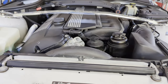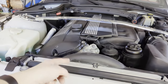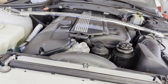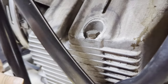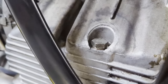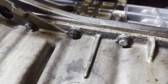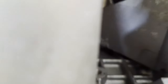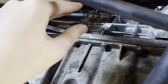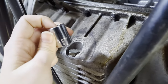If you're not working on a BMW, your filter may be screwed in underneath the engine, found close to the drain plug. Let's go underneath so I can show you where the drain plug is. Once you're under the car, identify the oil pan — look for where the engine and transmission connect, and the oil pan is right there. The drain plug for the BMW Z3 requires a 17mm socket.